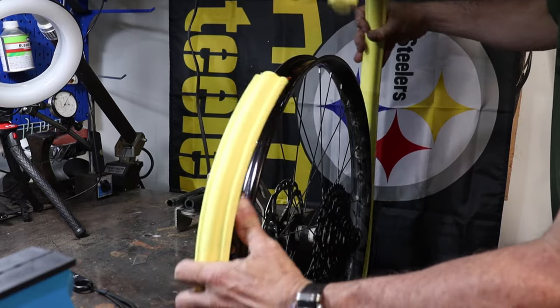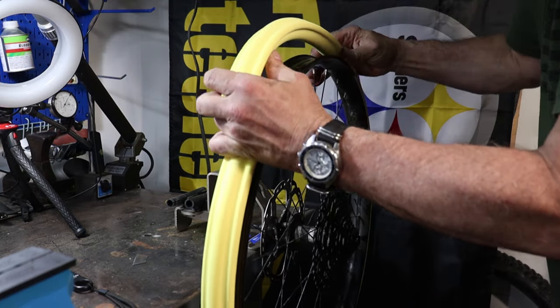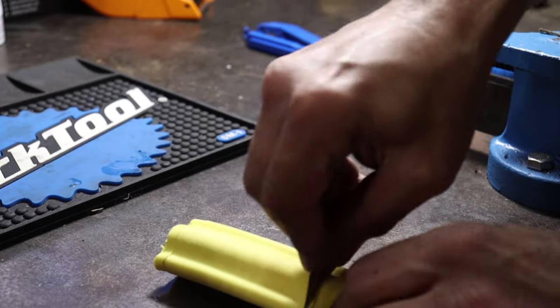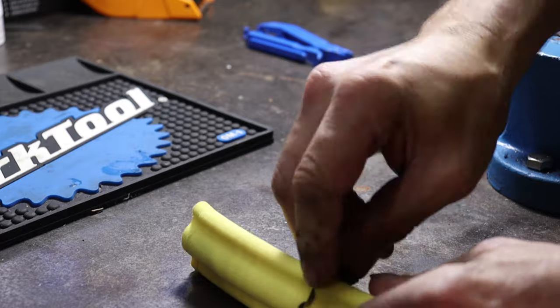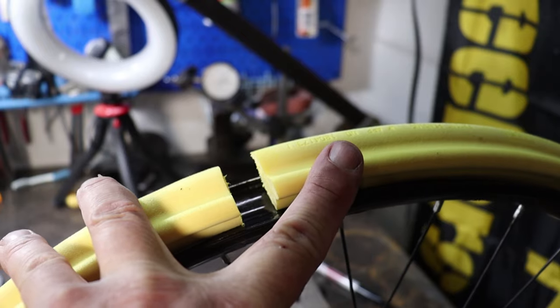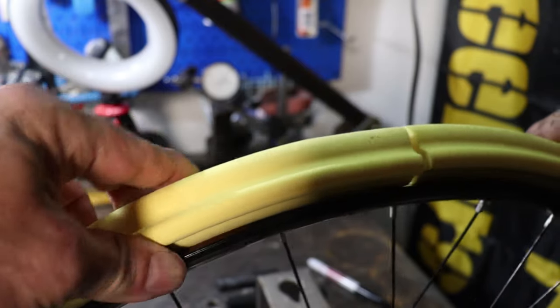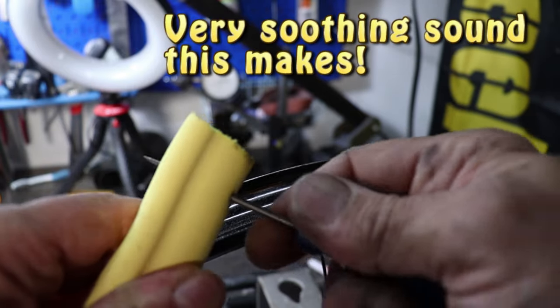The tire inserts are made of very dense foam which is hard to compress with your fingers, to give you an idea of their firmness. Before installing the tire, I carefully cut the insert at the seam with a razor blade, being extra careful not to slash my wrist. I then wrapped it around the wheel and cut it, leaving a half-inch gap between the two ends because these foam inserts are somewhat elastic. I simply stuck an ice pick through both ends of the inserts and pushed a narrow zip tie through to connect the two ends.